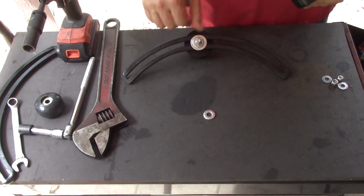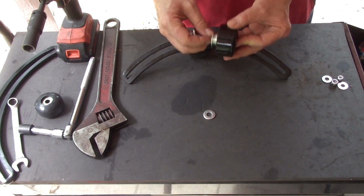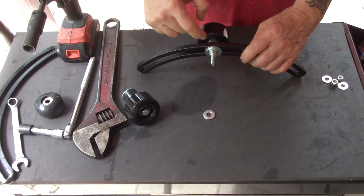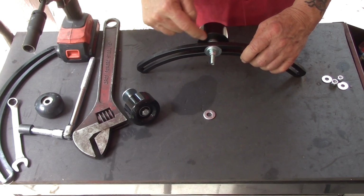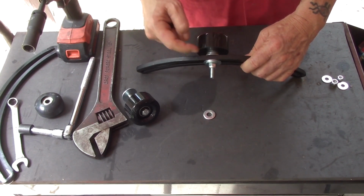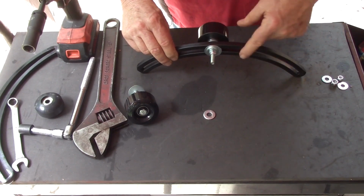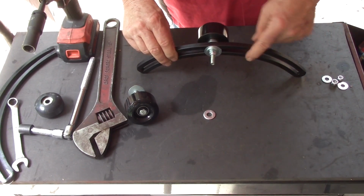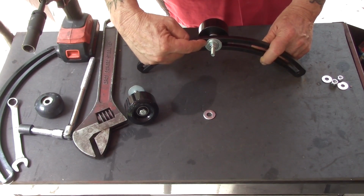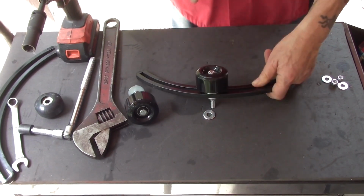Now I'll include some additional washers to give you some flexibility in your mounting. You can see what we're doing here. We've got the 1/4" washer up against the wheel. Then we've got however many 5/16" washers behind that. Then you've got the fender washer, which is going to ride against the arch piece here. Then a 5/16" washer, then you've got your nylock nut.